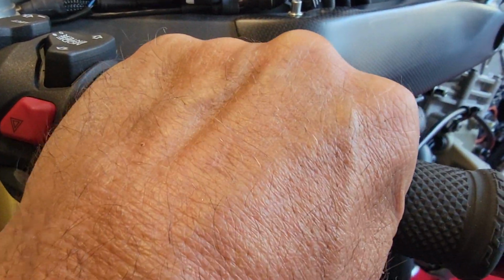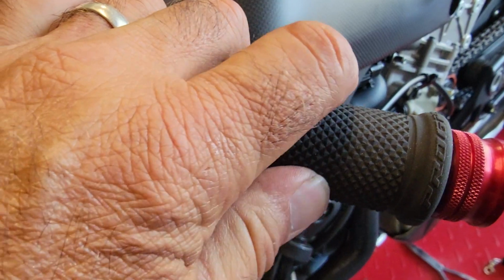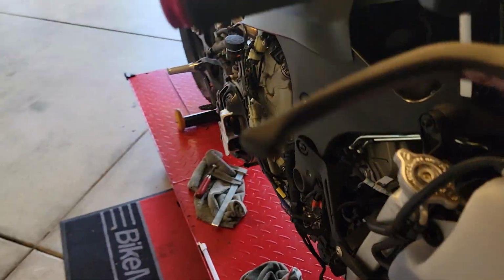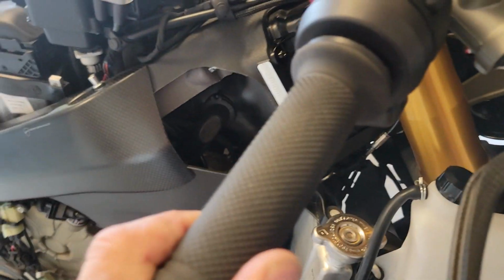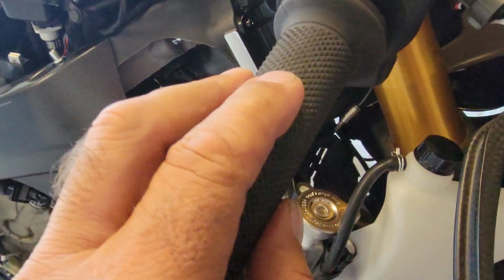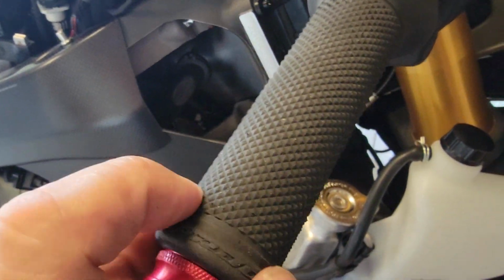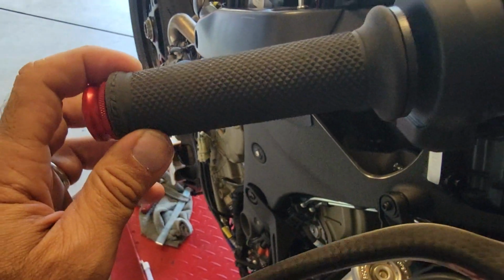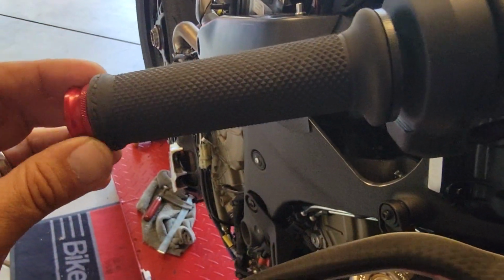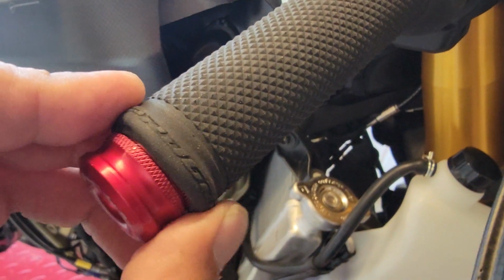I actually like these grips. They are soft-ish, so grip-ish, and thicker. I have big hands, and I like to have those grips a little thicker, so I'll leave them on. I actually have the MotoGP grips there, but I'm saving them, keep them on until they're worn. What I gotta do though is to safety wire these, because they keep sliding down, and so this is a little safety tip for y'all.